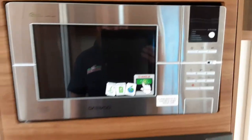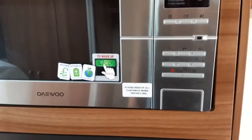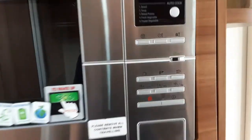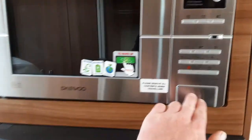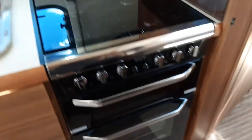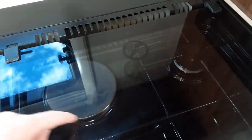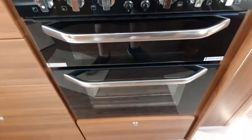The microwave is an eco microwave — you need to hit the eco button for it to wake up. It will time itself out after a short while, so just turn it back on with the eco button on the right-hand side. The rest of it operates like a household microwave. When travelling, you do need to remove the microwave plate from inside. The hob, grill and oven all work very much like household appliances — the only difference is that if you're not on 240V mains you will have no electric ring at the back of the oven; the igniters on the hob work from the 12V power on board the van.